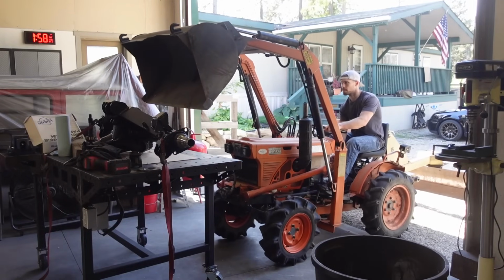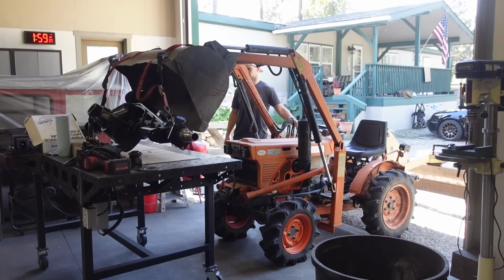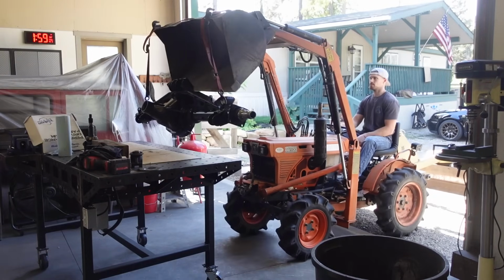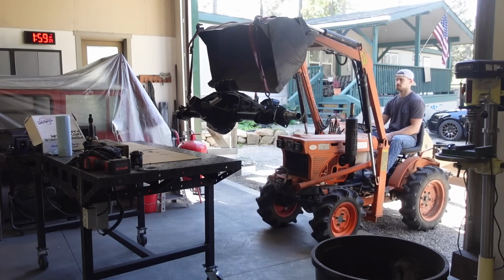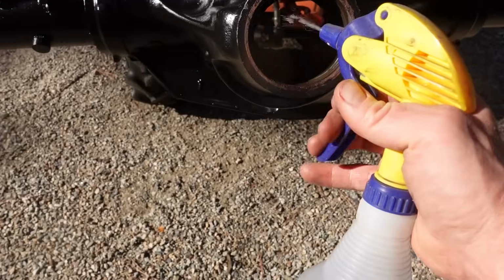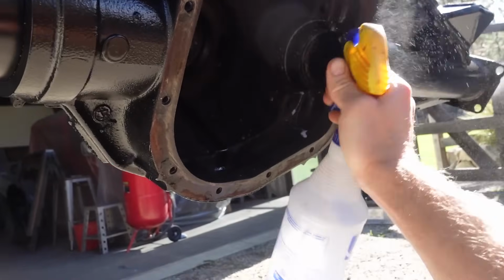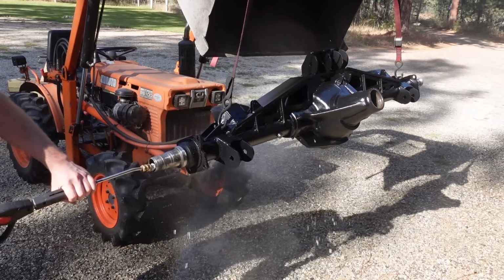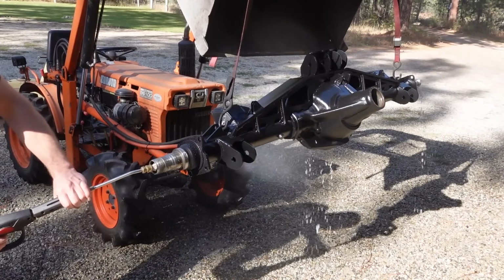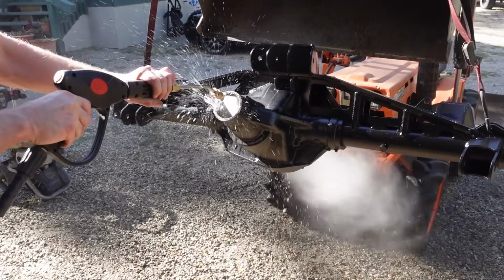I wasted so much time going back and forth with pinion bearing preload on the front axle. Another thing we got to do right off the bat is get our new ring gear installed on our new locker. Just like the front, I decided to just go front and rear with the Grizzly lockers from Yukon. These are mechanical lockers, so they lock up fully, and then when you turn, they have a mechanical slippage to them, so you can still turn. But then when you straighten back out, it's completely locked. So we got to get that all bolted together.